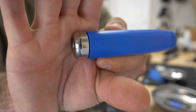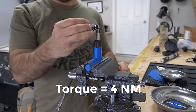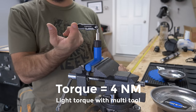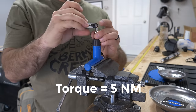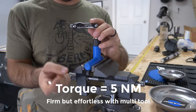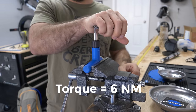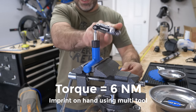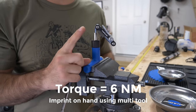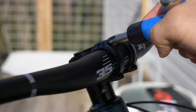With my torque wrench set to 4Nm, it's very, very easy — I can pull it with my finger. At 5Nm, it's definitely firm but not bordering on difficult. At 6Nm, I'm going really firm with my hand and you can see an imprint. Torque is a lot more important when you're dealing with carbon parts, but even on alloy parts you should be careful.